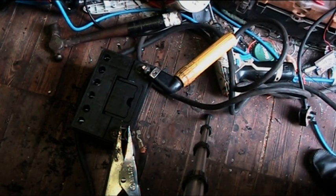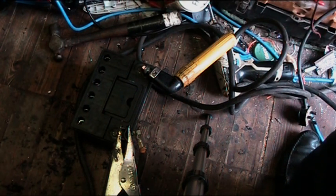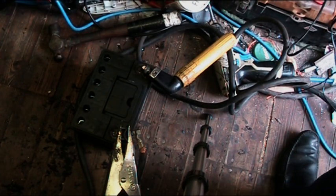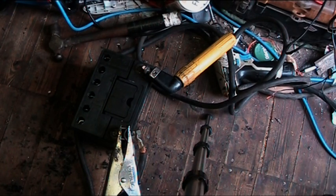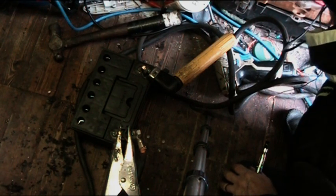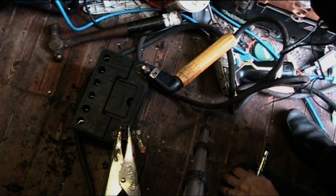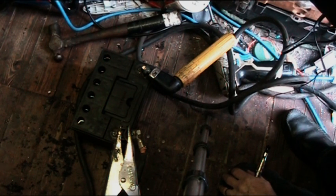Now, the next stage is to plug in. This particular welder runs off a transformer. Make sure your welder's turned off. Plug it in, and then turn it on. Right now, at the moment, it's on minimum. In this case it's 5 amps. It depends on the welder, of course, what the minimum will be. But turn it right down to minimum, make sure you do. And if it has an arc force, turn that down to minimum as well. It's only the amps we're interested in.